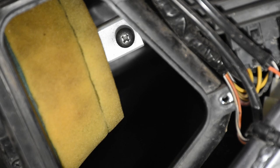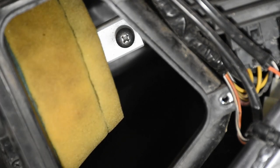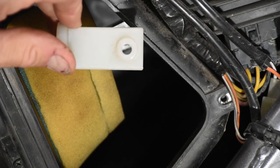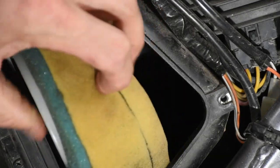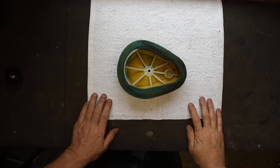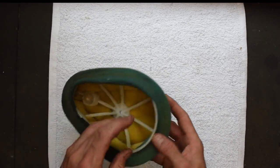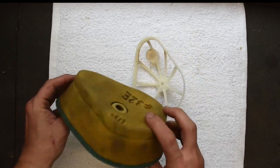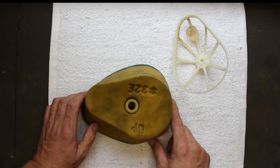These are the captured nuts. You can see they just fit into a little slot here, and if you over tighten them you'll actually enlarge that plastic area and the nuts will start falling out — it literally will drive you nuts. Now inside the air box you can see the foam filter, and right over here is the one last Phillips head screw that retains that filter in place. So I'm going to try to get that out of there without blocking the camera too much.